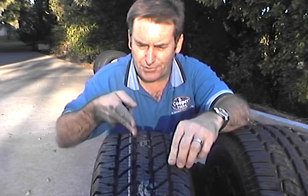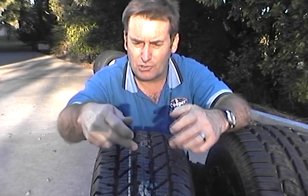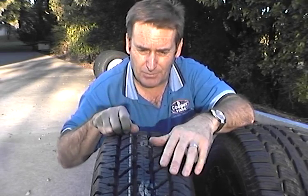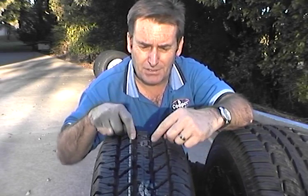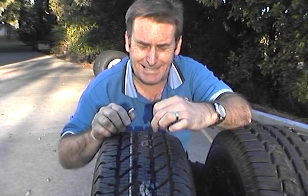And a very straight through tread. We call these see-through treads, which means if you spin the tyre you'll see straight through that, and of course the water will go through the tyre and out the back. Keep the tyre flat on the ground, reduce aquaplaning. Be careful of some of the older treads in the highway terrains. They have some very low tread depths in the tyres. That's the other key aspect to look for.